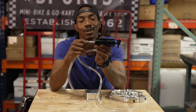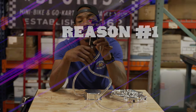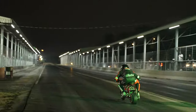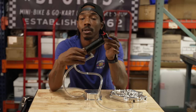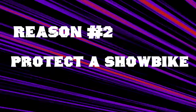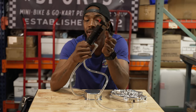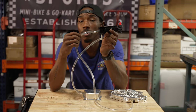Alright y'all, first let's get into the reasons why you want to use an aluminum catch tank. One reason is you have a really high output engine that revs really high and builds a lot of crankcase pressure. You need to release that pressure into an aluminum catch tank. Another reason is you have a show quality bike and you want to keep your motor clean from all oil residue blow-by and such — you release all of that blow-by into your aluminum catch tank.